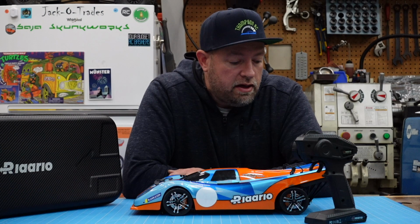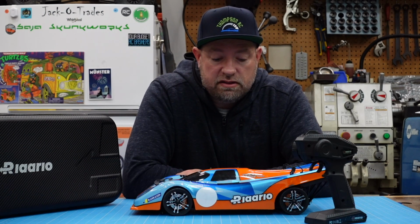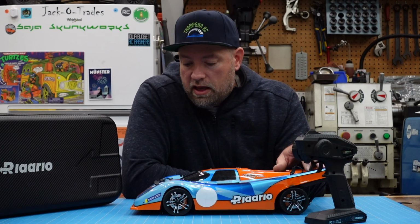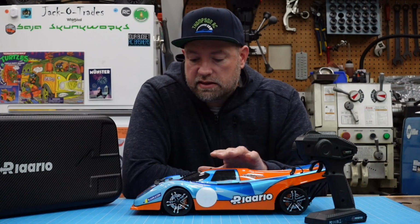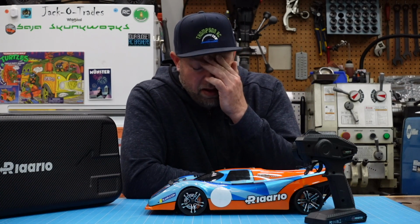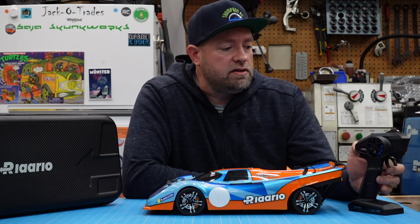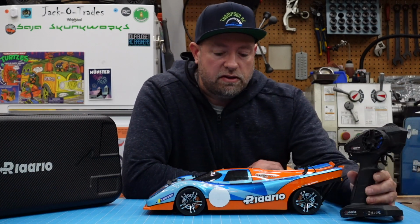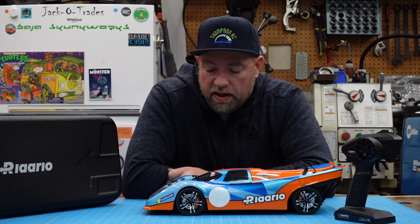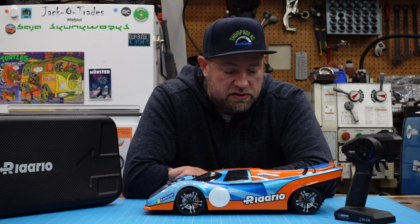The steering on this car out of the box is atrocious. It's really unmanageable. It's a combination of the remote and I think just the squirreliness of the car. I don't know how to describe it. I've done a couple of things since then to improve it. You know, I've toed in the wheels. So when I was doing my runs, I was having to turn down the rates on the radio to about 20 to 15%, just so that it wouldn't get away from me. And then as you go faster, it gets even harder and harder to control.